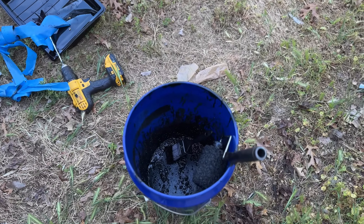I just finished up — took me a couple of days. One thing I learned: the paint had separated into a really liquidy part and a chunk of rubber powder material at the bottom. They tell you to just add the hardener and shake the can, but it doesn't work — at least it didn't for me. I ended up buying a paddle mixer and putting everything into a five-gallon bucket. It still gave me enough time to work it because you have about a 30-minute shelf life before it gets too hard. I cut the tops off all the bottles, poured them in, added the recommended hardener, and used the paddle mixer to break up all the chunks.